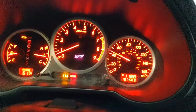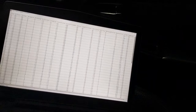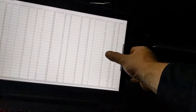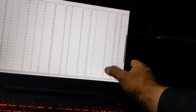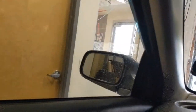I smell a lot of oil smoke right now - the turbo is freshly assembled so there could be some oil on the housings. Looking at the log, I had a knock event right at 6,700 RPM, negative 2 right there. Commanded fuel was rich at 11.1. But I'm seeing a slight rising trend on the boost at the top. It's a late rising trend - much later than usual boost creep - but it is still rising, which means this thing could potentially suffer from a little bit of boost creep still. It's not like the stock housing where it would be way higher.